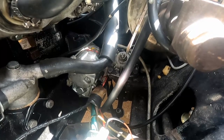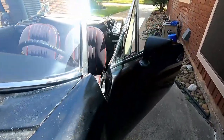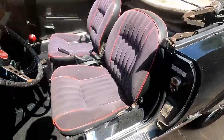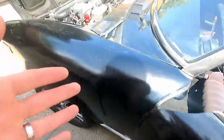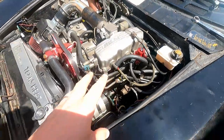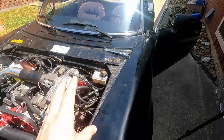We're going to turn it a quarter of a turn, come out, try the steering one more time, and take a look at our play to see how much we've got. If we still have some more slop, we'll do another quarter turn. The key here is to not overdo it right away — you want to do a little at a time until it's nice and tight. If you overdo it, you can break it.